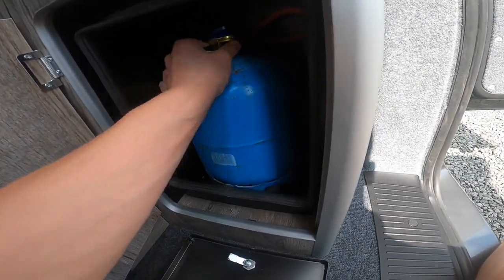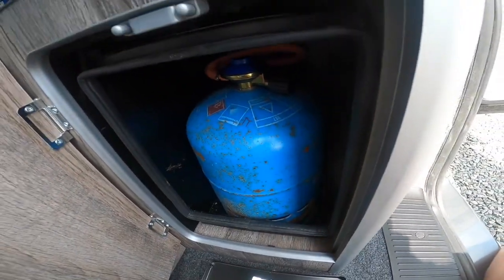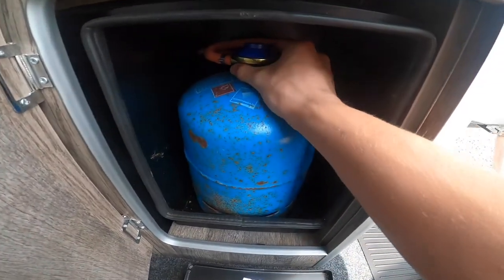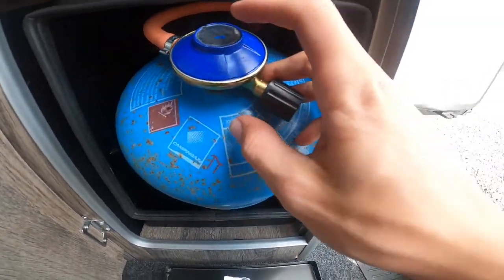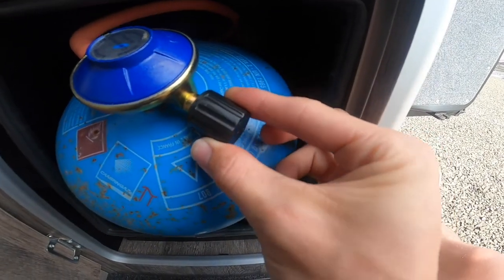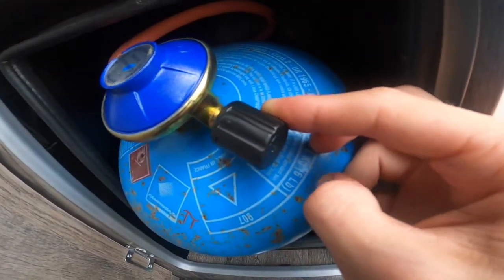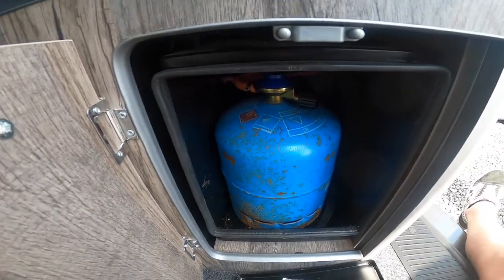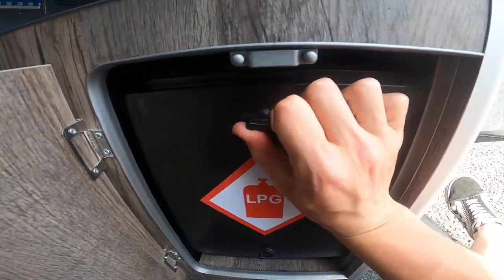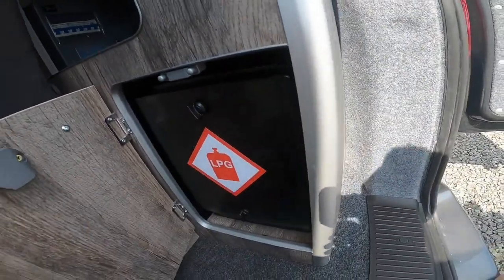For LPG, turn the toggles to release the door and you can take this off. This is a camping gas bottle — it's a 907, so if you wanted to get a gas bottle for your vehicle you need a camping gas 907 bottle. It's a bottle-top regulator, so you just spin the bottle to tighten it onto the regulator, then use the black knob — minus turns it off, plus turns the bottle on. Always make sure it's turned off before you start traveling, just in case anybody goes into the back of you, so the gas is off and safe.